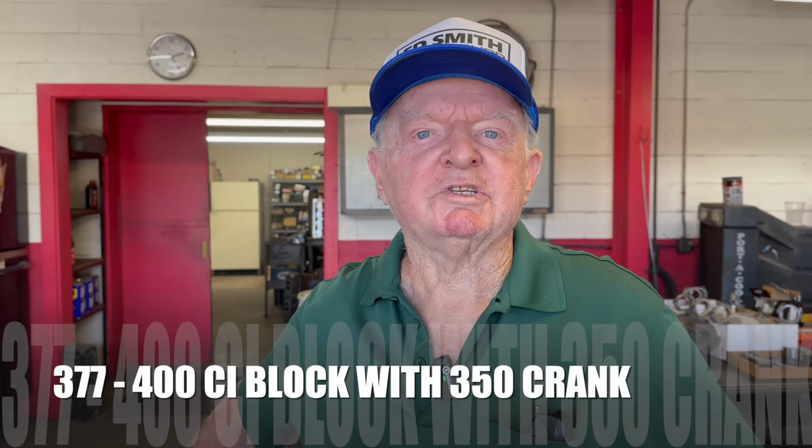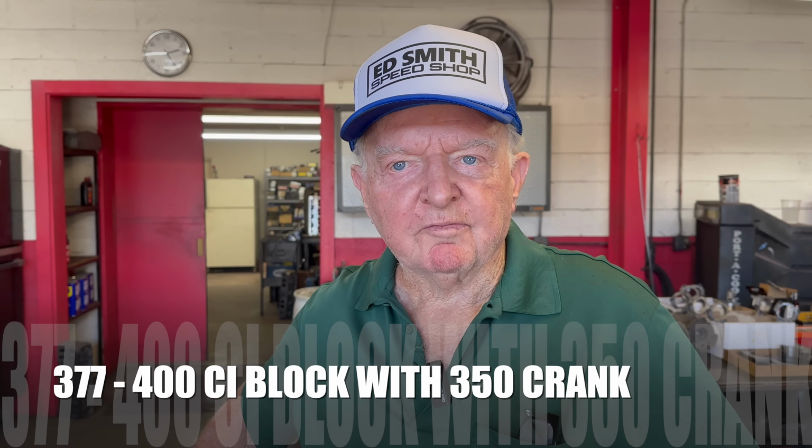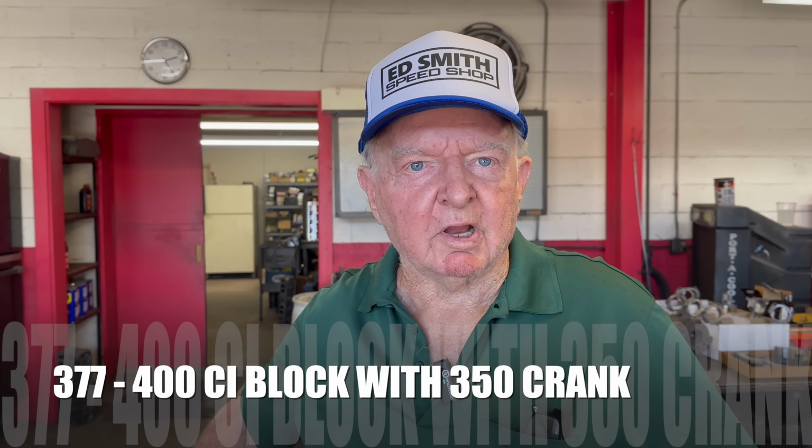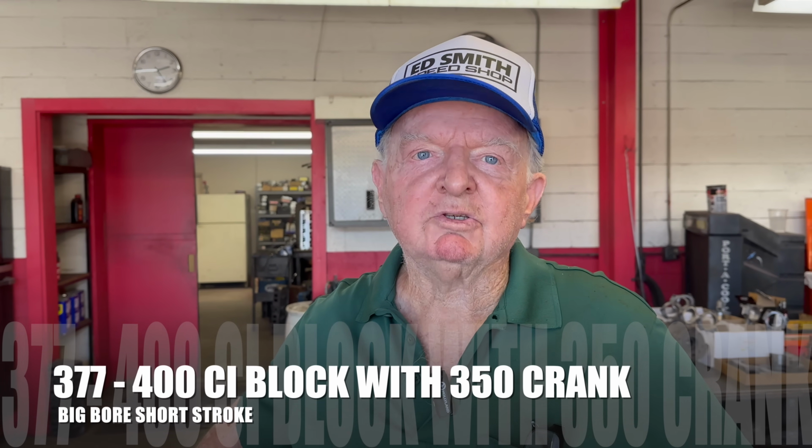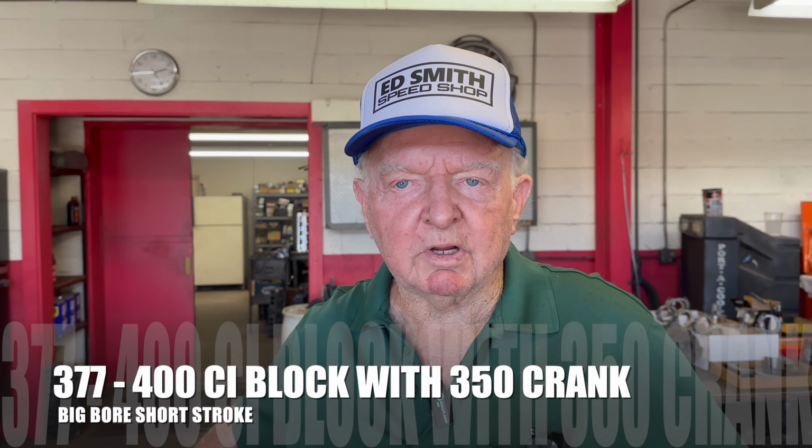So we built some motors over the years, bigger motors, and I've had some small block Chevy motors, 434 cubic inches, that would be raced on a mile track instead of a 3/8 track. And we did our 377 motors, that would be a 400 cubic inch with a 350 crank, a big bore short stroke type thing. That was good for some 3/8 tracks, but our favorite probably is the 383 stroker motor.